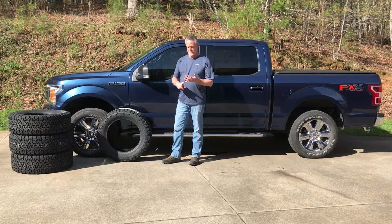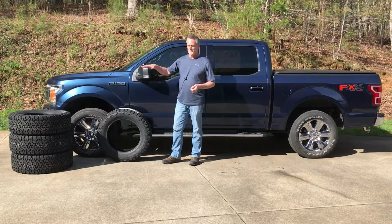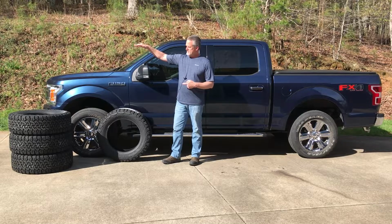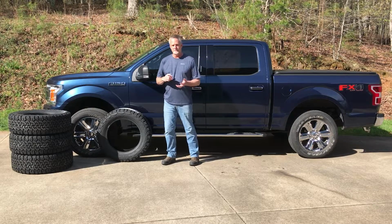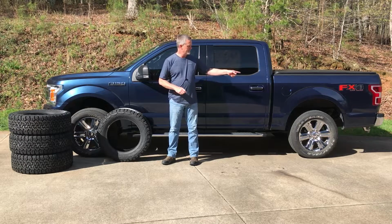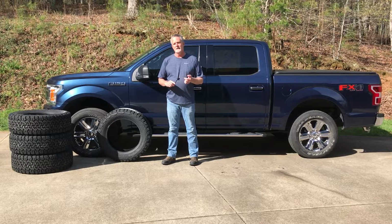I'll go over the headlights before and after. Before, they were at 40 inches at 25 feet away. After I raised it, it went to 44 inches. So I had to drop them. The hitch height, the hitch on the back of the truck, it dropped a 1/2 inch. It's now at 16 3/4 inches. 17 inches is about normal for hitch height.